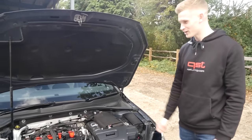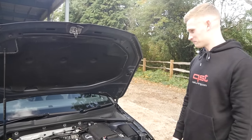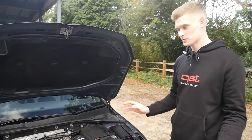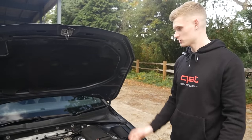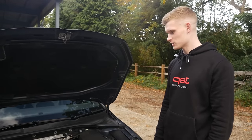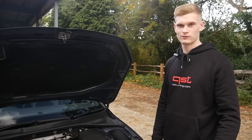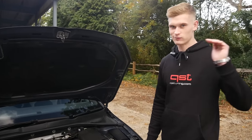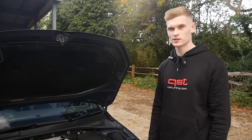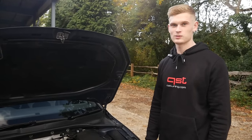NGK race spark plugs as well. It's still the stock block — the engine hasn't been opened up at all. Stock pistons, stock rods, stock valve springs. So we capped the boost on it to 2.1 bar, but it still makes 560 horsepower with the meth and 620 Nm. It's a really nice flat torque curve holding over 600 Nm until around 6,500 rpm. So it goes pretty well.